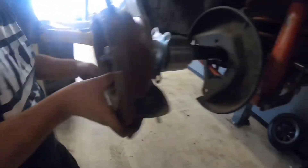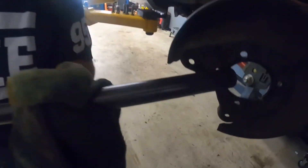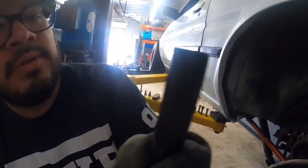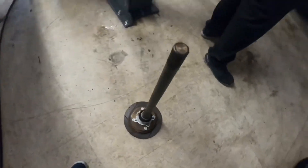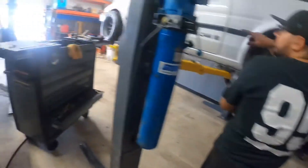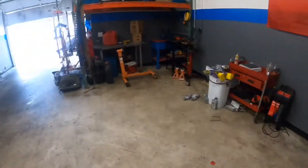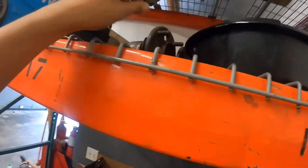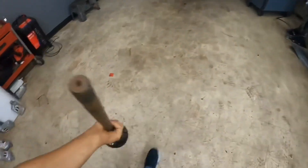I see the damage. I forgot how thick these axles are. Oh damn, those are sweet. These are 28mm, right? 28 millimeters. The stocks are 25. And you have those over there? I won't have any need for these other axles. So these are my old axles — these are 25mm. Upgraded up, you can see the difference in size. We are putting in the AC turbo axles. This is beefier.